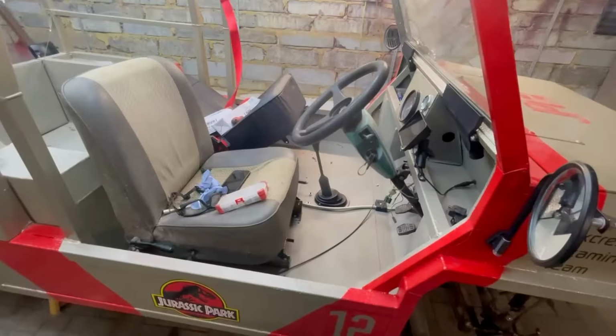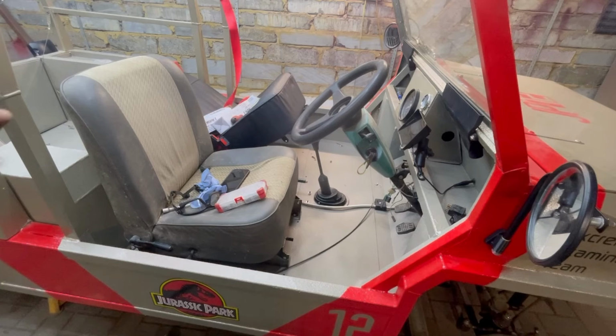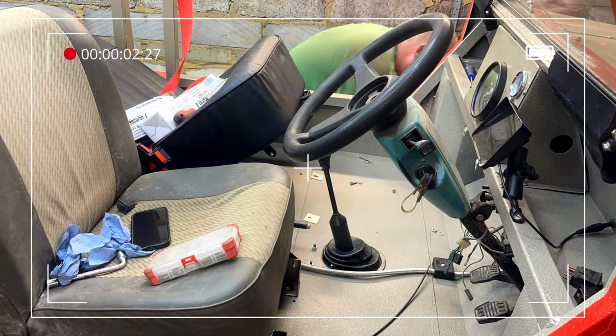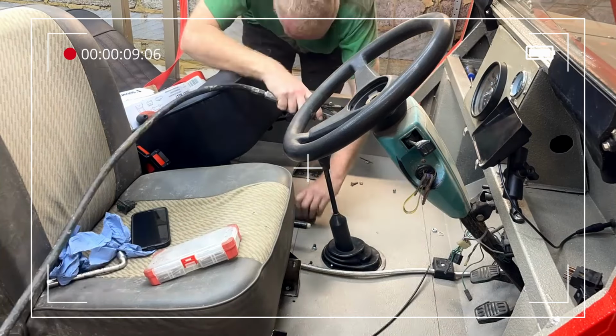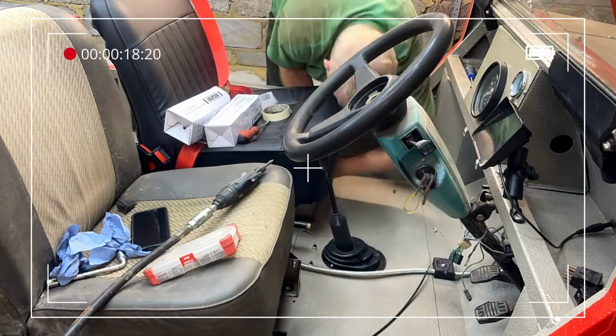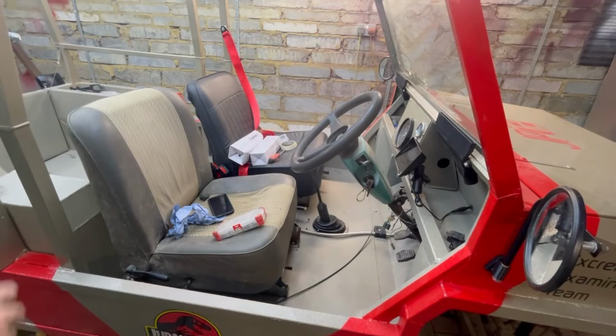Okay, time to bolt the passenger seat in. Just going to elongate the rear hole slightly, just to move them away from the cross member, so we've got room for washers and to even get the socket on. And then we'll bolt that down. Oh, I need to make some spaces for the front. I'll do that first before the time lapse. Okay, that seat's in. I've just got to move it back. It's always been on the forward setting. I don't know why, but anyway, that's bolted in.